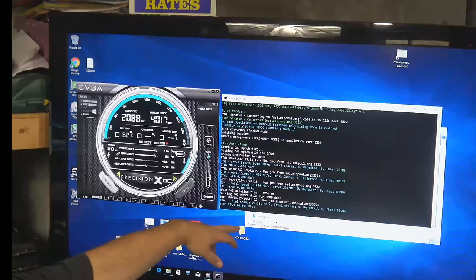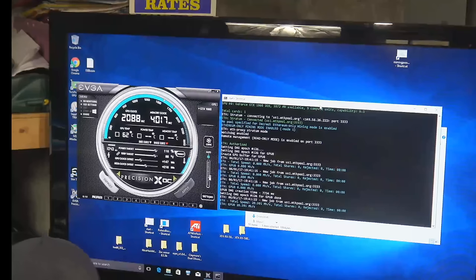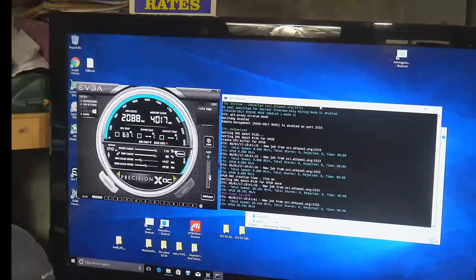I mean, it's not winning any races against like a 570 or 470, but right now with desperate measures on cards, if you can't find anything, you're talking 20.3. That's about 130 watts right now, with 35 to 38 of that being on the board and system board. So you're looking at just 100 watts for the card. And that's with the overclock.